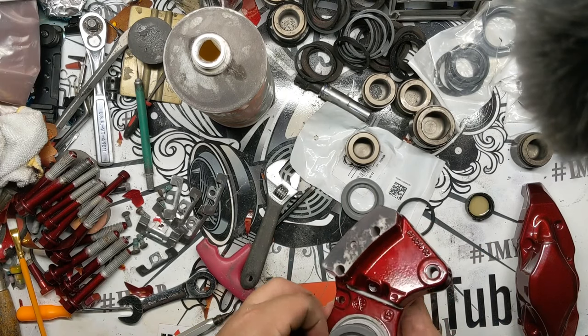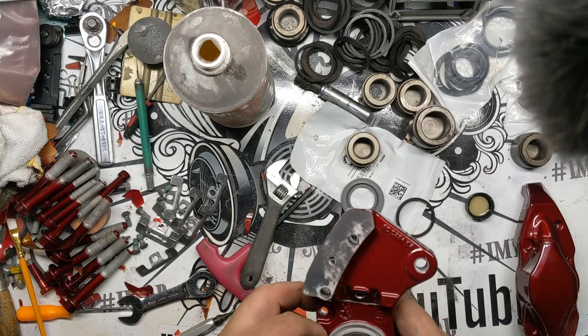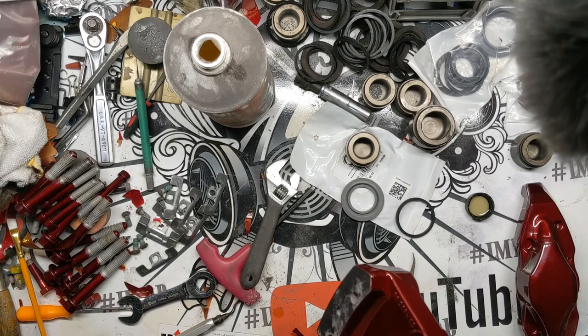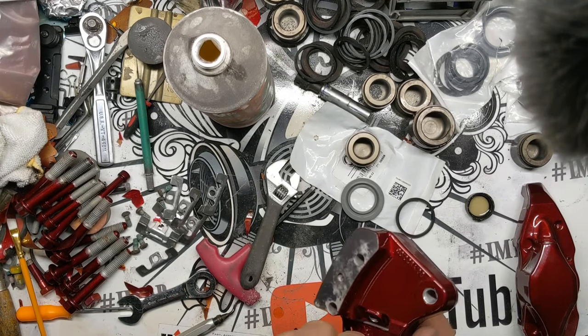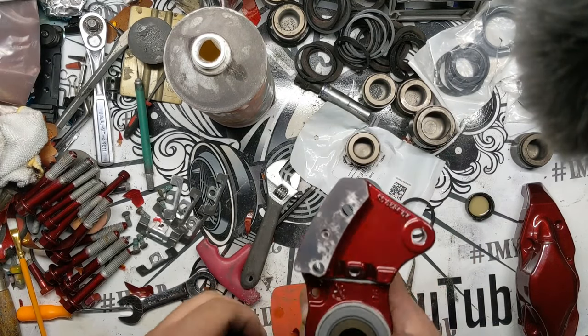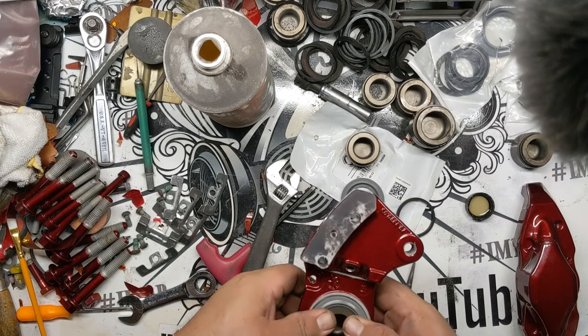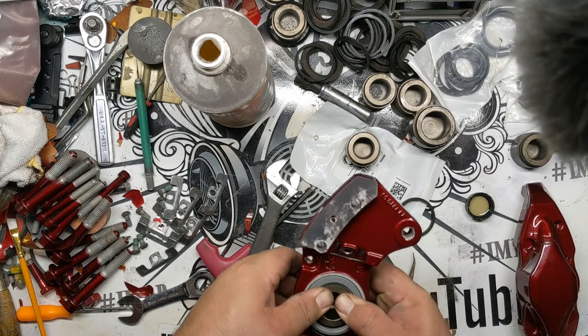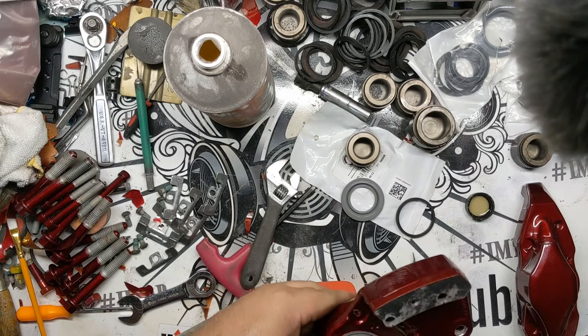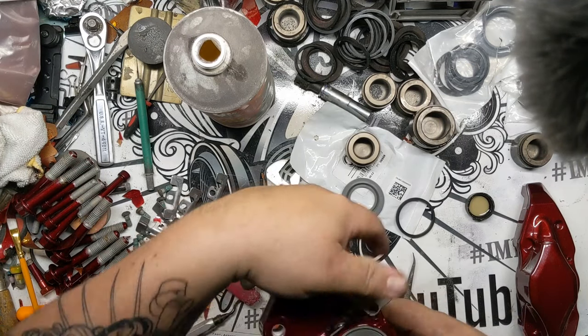Then you're just going to throw this dust seal on these. And you can't really put it on wrong, I mean, yeah, I guess you could put it on wrong if you're ridiculous. I usually put it on, then pull up a little bit on it like this and spin it. That way I know it locks all down in place. Shove the piston back down and in. And just make sure that you seat the dust cap all the way down.